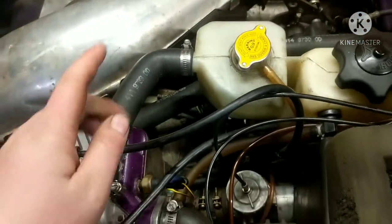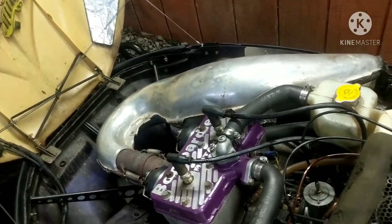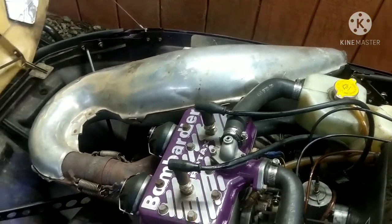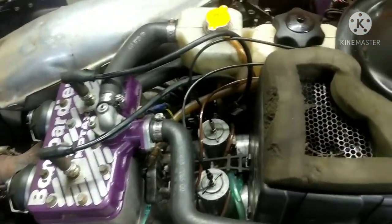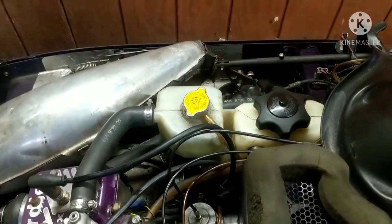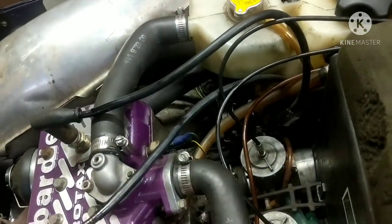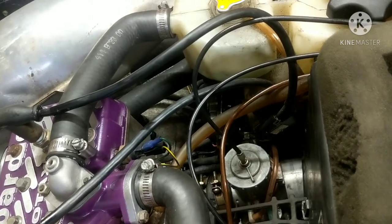The only issue we even had this weekend was we were just about across the street coming back in, and he said it felt like it was running on one cylinder again. So we made it back, and I was giving it a visual inspection, and I could tell that the fuel was dripping down to the belly pan. I was looking around the fuel pump area, and I just saw fuel pouring out. I thought it was maybe the main line coming out of the tank, but it seemed all intact. I was like, my fuel pump's leaking already? I can't imagine that.